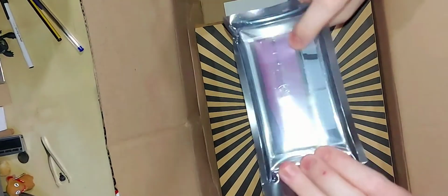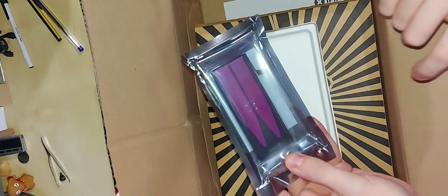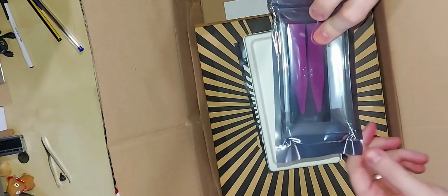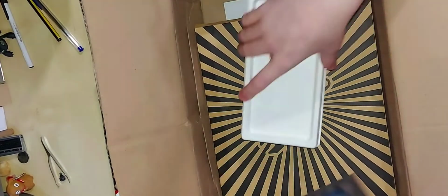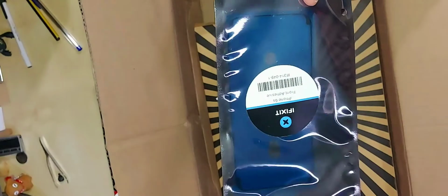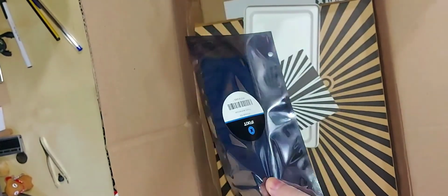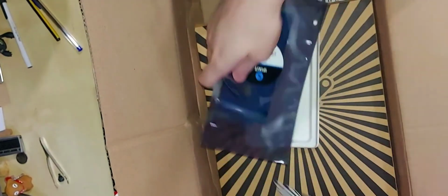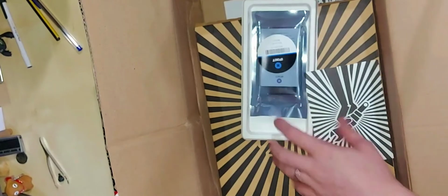And the 6S battery. So as you can see, it's got the pull tabs already installed, so you just take the pink off and install it, and it should be just an easy swap over and done. And here is the adhesive for the outside, well, between the LCD and housing. So after I take the top off, I'll replace the sealant, and then hopefully the battery, and then hopefully put it back together, and it'll work perfectly fine for the first time doing it.